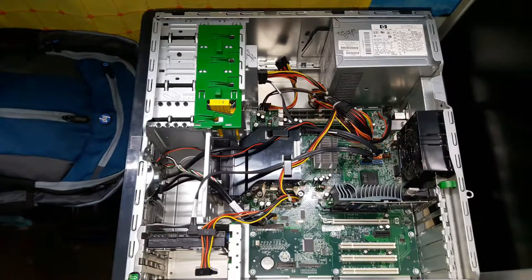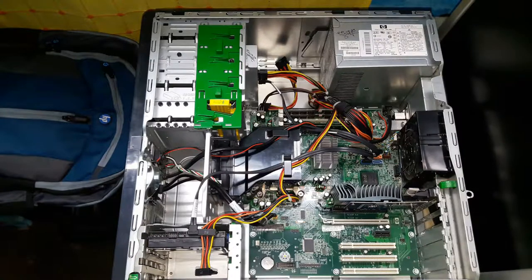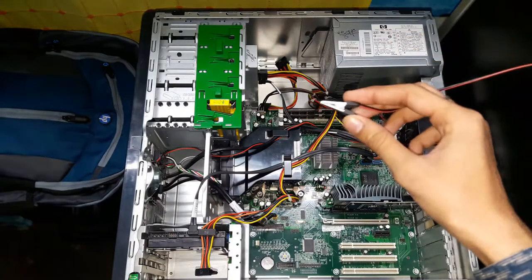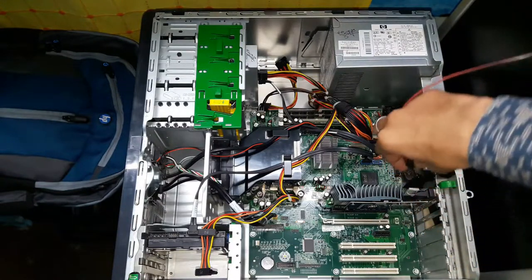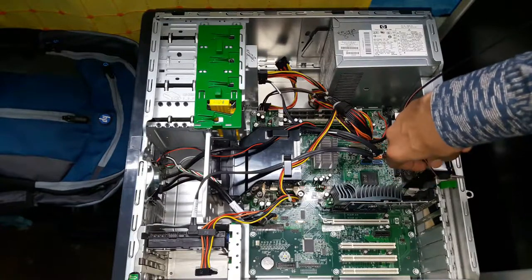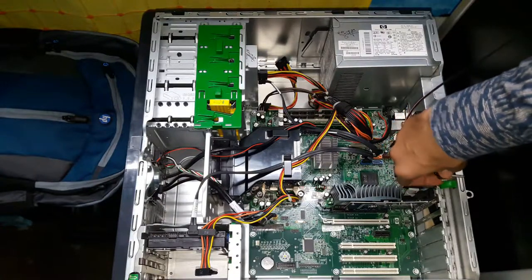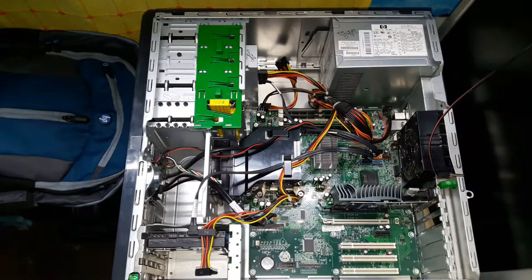This is my PC cabinet, matched up with all these wires and SATA cables. So now I'm going to take this grounding clip and connect it to the metallic body of the PC cabinet just like this. It will discharge all the charge — if there is any charge present, it will discharge all the charge from the PC cabinet so it will be safe for us to install the hard drive.